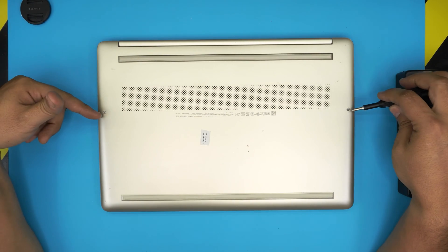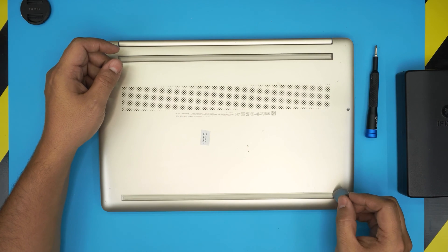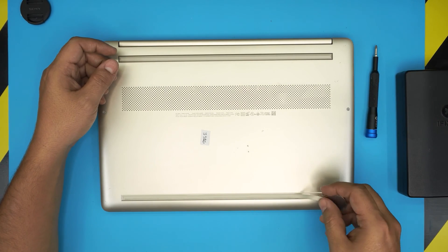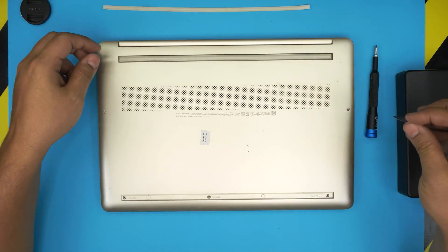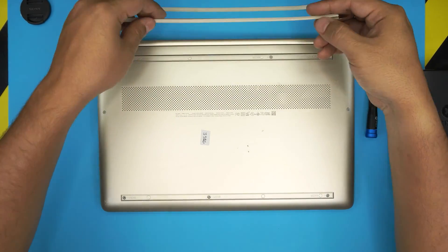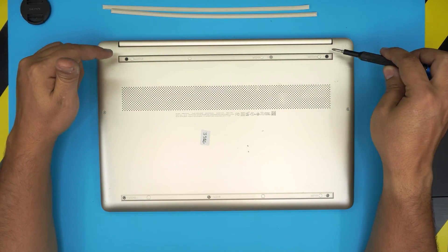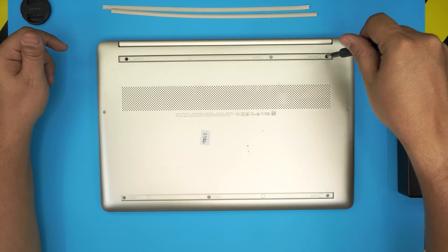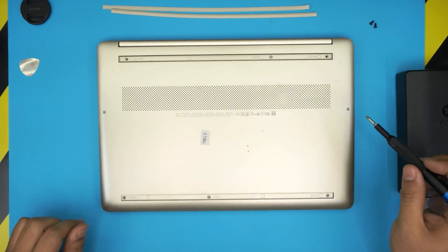Down here we can see two exposed screws, but there are a few more hidden ones. Remove the front rubber leg by placing the opening tool right underneath and peeling it off straight upward at a 45-degree angle — don't cross over or you'll snap the rubber. Do the same on the back side; it's a little thicker so peel it gently as it has adhesive tape. Remember: the two black screws go in the corners on the hinge side, and the chrome screws are all the same size and height. Remove all screws and keep them in two separate piles — black in one, chrome in the other.